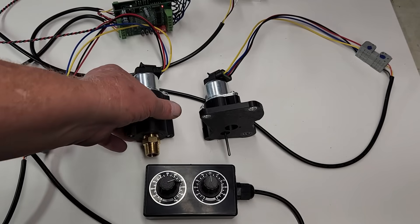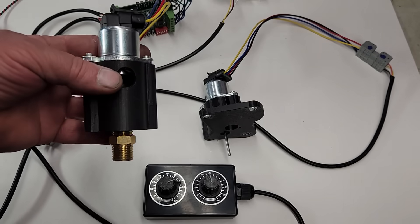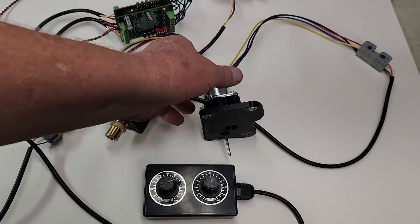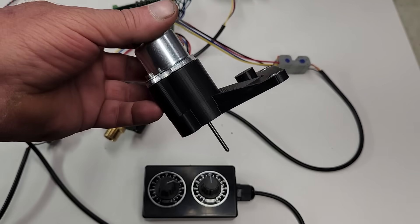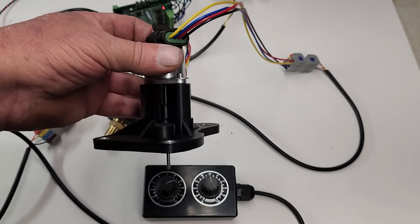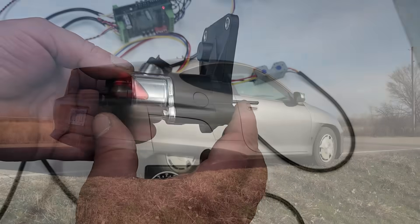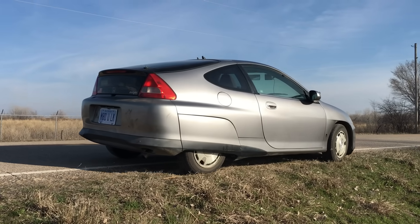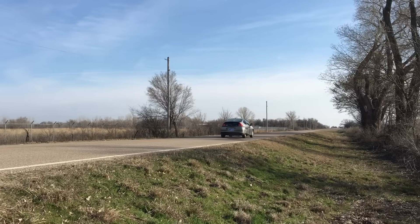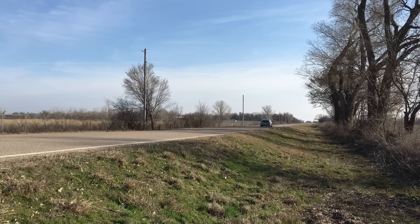This guy is a linear boost controller, or linear blow-off valve — I really don't know what to call it — but in theory it should help regulate the boost generated by the AMR 500 supercharger. This other one is an electronic fuel rack limiter, and its purpose is to keep the governor from briefly slamming the fuel rack wide open when the car is driven under a light to medium load. This little diesel engine has a nasty habit of letting out a puff of smoke under light acceleration, because we've manually adjusted the fuel rack limit to exceed the factory calibrated limit.